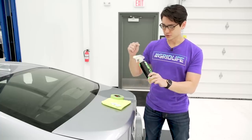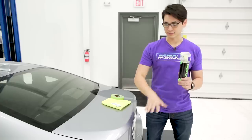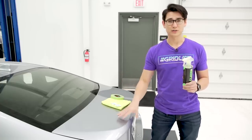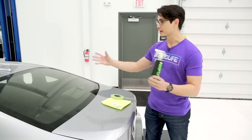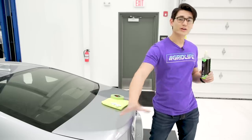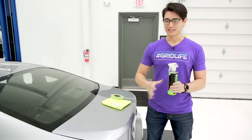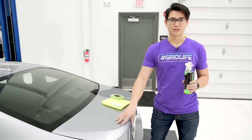If you're going to do this, make sure that there's nothing in your quick detail that's a sealant or a wax, because that's going to make it slippier and harder for the 3M adhesive to adhere. Also, if you've already applied a wax or sealant to the entire car, that's going to make it tricky. You'll want to remove as much as you can using a degreaser or Dawn dish soap to get as much of that wax off so you get nice adhesion to the paint.